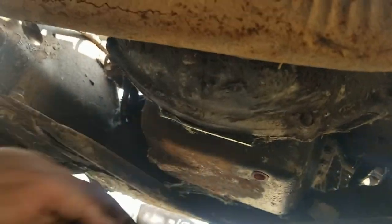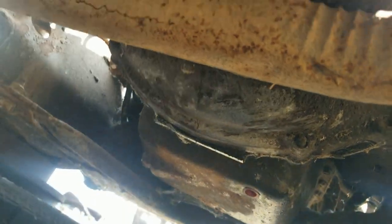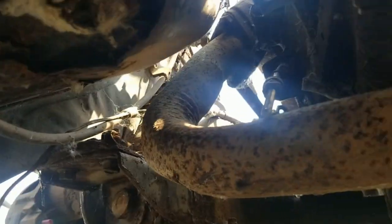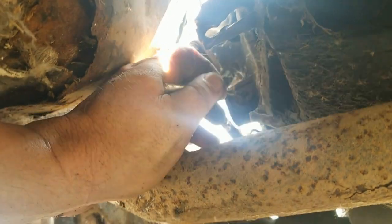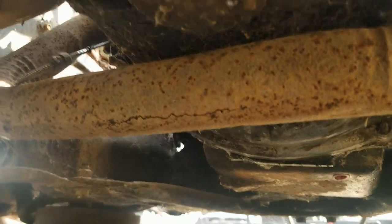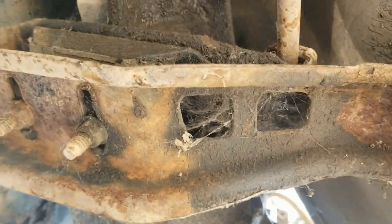So, I got those out. I have to get out these bolts. I suppose the starter. I got this clutch cable freed up from this end. I can't see what's going on the other end. I'm sure we'll have to deal with that. And then the motor mount or the transmission mount cross member. Hopefully that's not a big deal. Because we're already gonna have to reef it over that exhaust pipe. That'll be great. Maybe them bolts will come out.